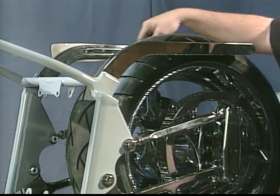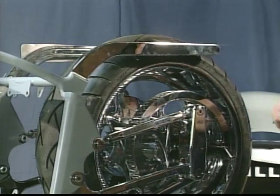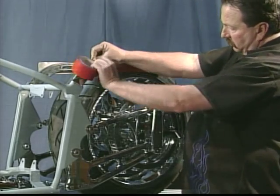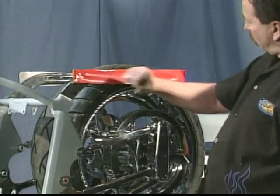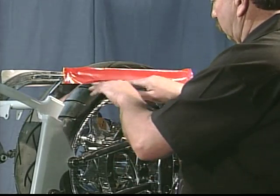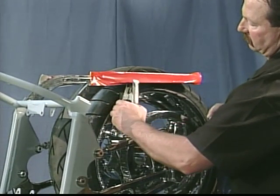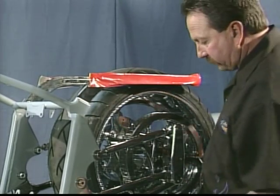I've already protected the other side of the fender strut with two pieces of duct tape. When you install this duct tape, you have to be careful because it will pull the chrome off, especially if the chroming was not done well. Just barely pull it off and let it set — barely put it over, just lightly. Don't rub it in, don't scrub on it. This is protection for the clamp so the clamp doesn't scratch the chrome. These rubber tips that come on these clamps fall off after the first day or so.